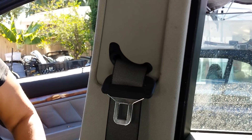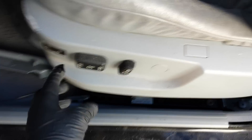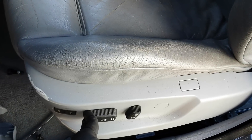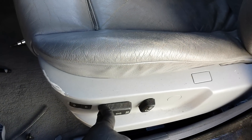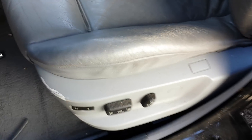Once the cable is unlatched, go to the side of the seats again, get power to the seat, and push it back — because now you want to get access to the bottom connector. On these cars from 99 to 2003, the connector should be yellow; if it's not yellow, it's not compatible with your car. Lift up the seat back here and you'll have access to the seat connector right there. To remove it, take a flat screwdriver, pop this cover off, and then you're able to pull the switch out.